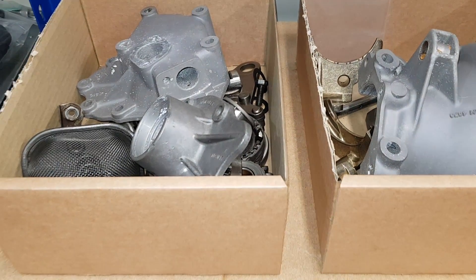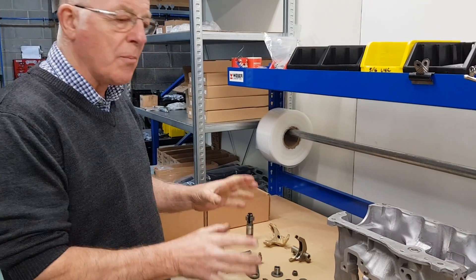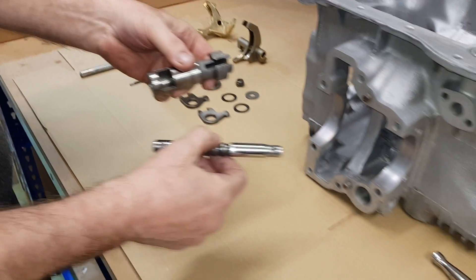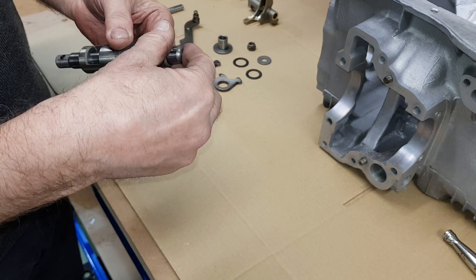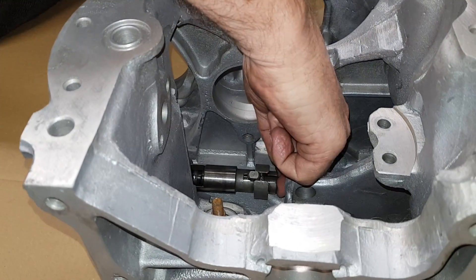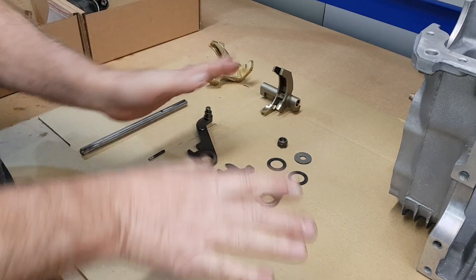At this point I'm going to hand over to Steve. Okay, we're now in the workshop and we're going to run through the process of putting this back together. First job is going to be to put the interlock spool back into the gearbox. This is the shaft, this is the spool itself, so this one drops into there — nice and free. From the inside of the gearbox, just pop it into the hole. These are part of the selector fork mechanism and you've got to get these in correctly. If you get them in wrong, no gear change.